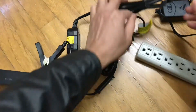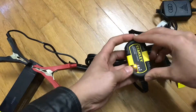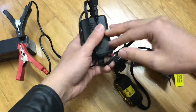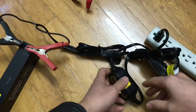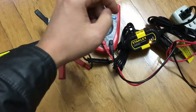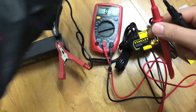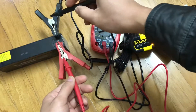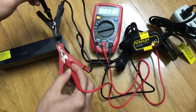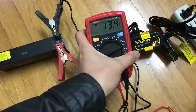So once again I'm going to use my voltmeter to check the voltage directly from the Stanley charger. You can see it's solid — it's charging. I never should have bought that other one, but at least I got a refund. Now I'm going to test how many volts this puts out to my battery — you can see it goes up immediately to 13–14 volts. That's a good voltage to recharge a 12-volt battery.